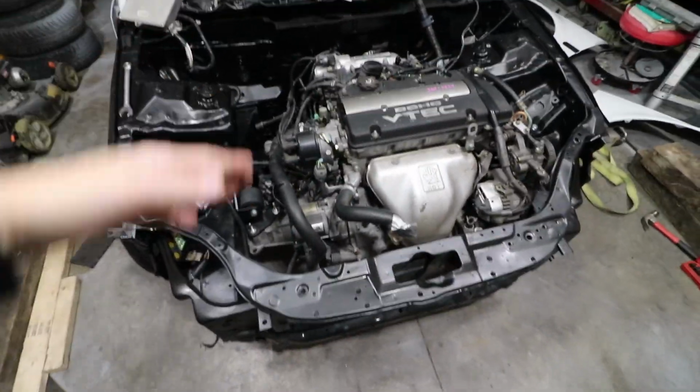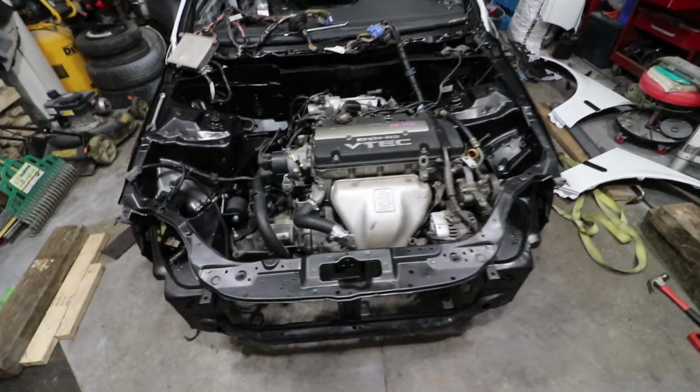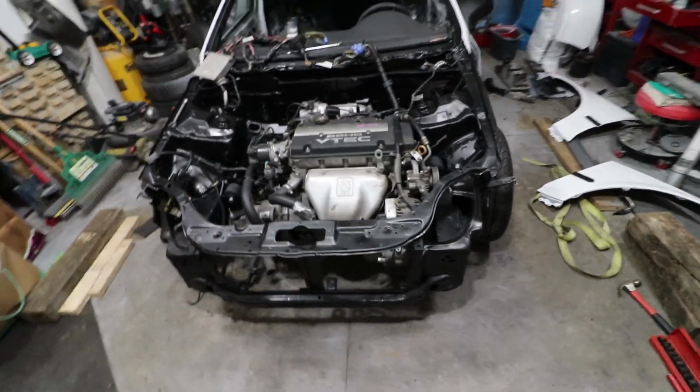It's underneath that mess of crap. The T-bracket mount itself was actually sitting a little higher, so we weren't able to feed the bolt through. So we had to back off the bolts on those two positions and then push the motor on the rear end, and we were able to feed it in through after that. And we were good to go, torqued everything down. And we're in good shape, honestly. A challenging process for sure.